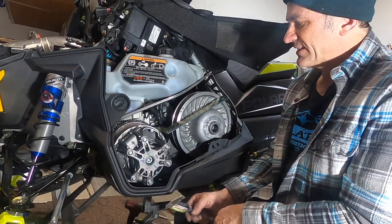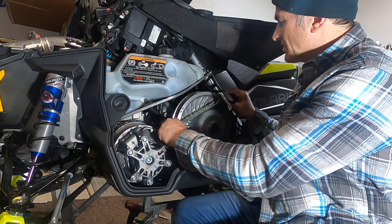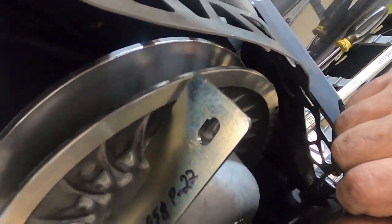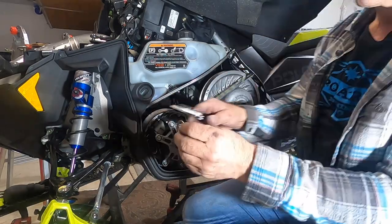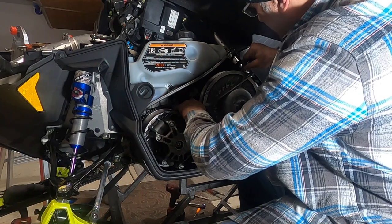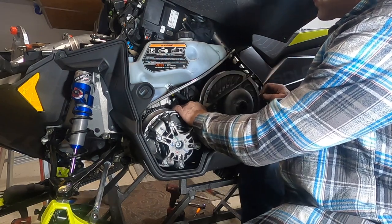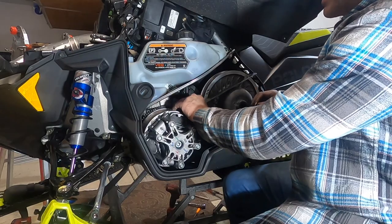Now I've got both TRS mounts in, and all the bolts are still somewhat loose holding the motor in. We've moved the motor a little bit. By just putting our TRS bar in, we're a lot closer than we were before — still touching in front where we're supposed to be, and we have a much smaller gap on top. To measure, I can use feeler gauges, or I can use one of these little spacers — this one's 60 thousandths — and try to slip it in. The 60 thousandths is a little bit tight, so we're at about 50 to 60 thousandths, which is still too much. We still need to move the engine a little more to get that lead-in down to 20-30 thousandths.